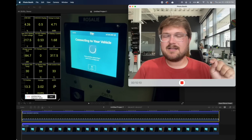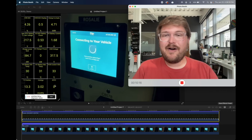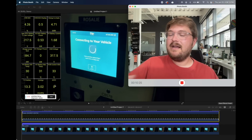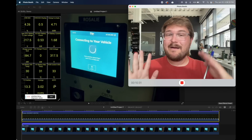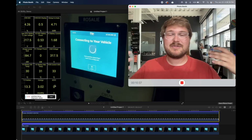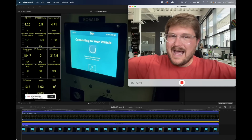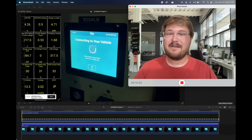We towed with this thing on some of the hottest days with big loads and lots of fast charging. And by far, the F-150 Lightning in the real world, in our testing, had much more stable thermal management and much better charging actually than even the Rivian R1T, because the Rivian kept overheating, couldn't keep itself cool. A lot of that can be adapted through software, but it seems like the Ford's almost a step ahead. And if you remember a year ago or even 6 months ago when we were talking Mach-E, me especially, I was like, what are they doing? This thing is overheating. It can't keep itself cool. The charging's too conservative. A lot of that has been fixed, and it really feels like it's the next generation building off a lot of things they've learned with Mach-E.